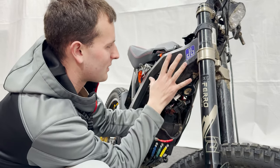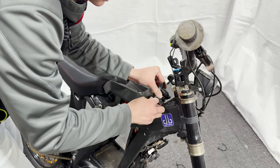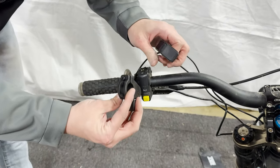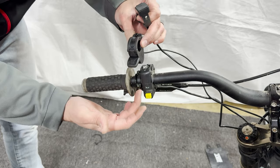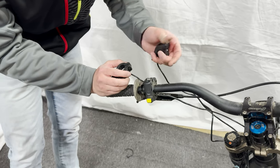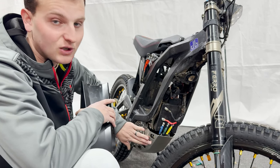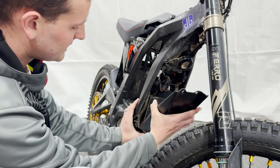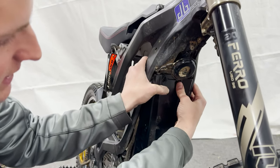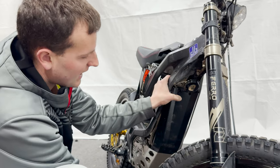Now your job is to tuck all the wiring back up in here — make sure all your wire routing is nice and clean. You'll get your key slot back on; that's just two screws to remove, and you have to do that to be able to route these wires up. We'll probably slide the brake lever a little bit and then put our display over here. His stock eco/sport mode switch is broken, but that's not a problem since we'll handle modes through the new display. He still needs the switch for his horn. Time for the cover — we do have an aftermarket skid plate, but it still fits. Tuck the bottom into the skid plate, wiggle it down, fit it under the horn, line up the two top bolts, and use the two longer 4mm Allen bolts provided.